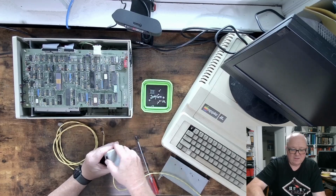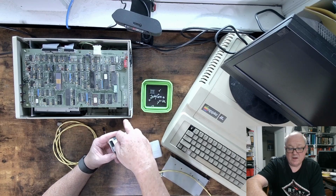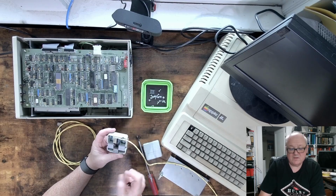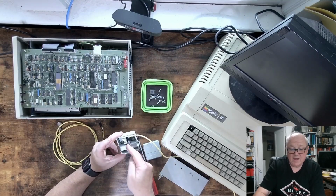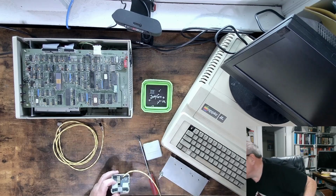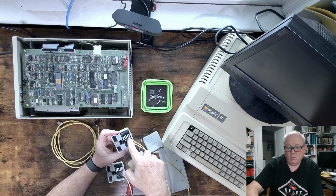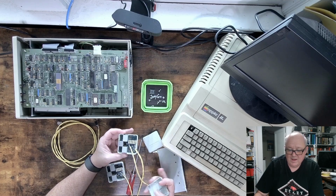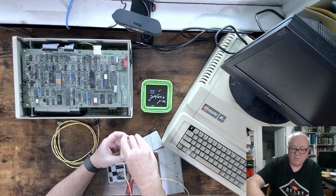But the interesting thing about these tap boxes is that inside they also have this, which you can lift up and slip pairs into these connectors, and it allows you to just strip off a little bit of the end of the wire, plug it in here, and you'll see there's 5 plugs. It's actually made so that if you have, I'll bring another one over, you can put 2 cables into it, and you put one of the cables into one set, one into the other set, so that's how you can daisy chain. And the nice thing about this is that if I make too short a run between the boxes, I can just cut a new piece of cable and very quickly wire it in.